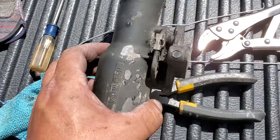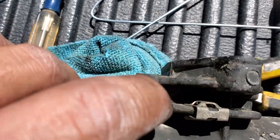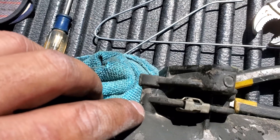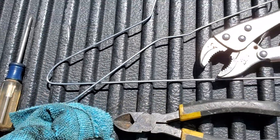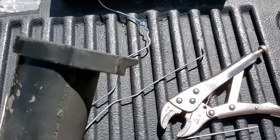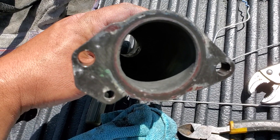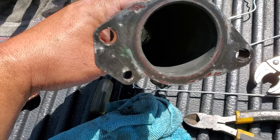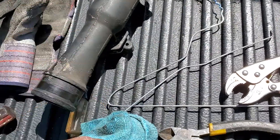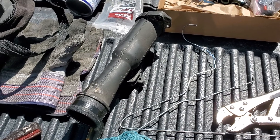On the other side it has the same angle — you can see it in the molding — but it bumps against this wall, and you'll start getting metal shavings if you use a drill bit or a screw to break it. So what I did was get a hanger, bent it into a 90-degree shape, stuck it in through the little hole, and then used a piece of wood to wedge it and force it downward to break up the soot. An O-ring puller with the 90-degree bend is probably the best tool for the job — that's how I got it cleared.